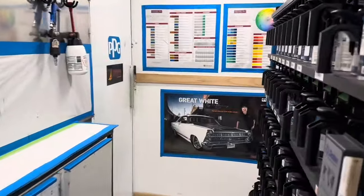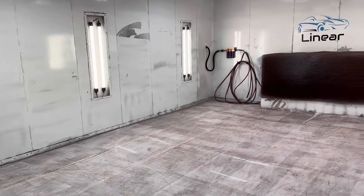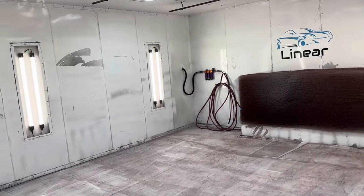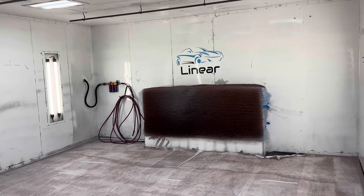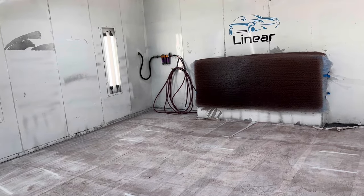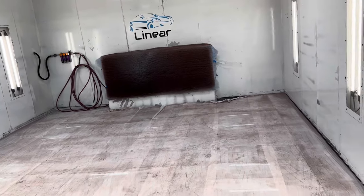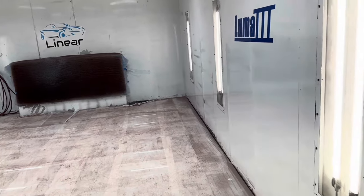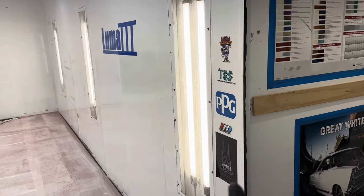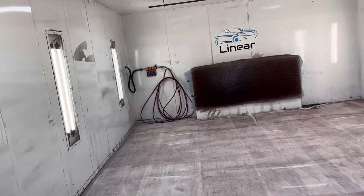And right in here is where all the magic happens. We just cleaned our booth out — painted some Harley stuff and a couple motors, but then basically just cleaned it out. Washed the walls, new booth mask on the walls, new dirt trap on the floor, new intake and exhaust filters. We revamped our exhaust venting and put some dampeners in so we can actually pressurize the paint booth. Instead of the exhaust sucking harder than the intake is pushing, we can adjust it so we can get the barometric pressure in the booth just right — the booth is pressurized so that when I open the door, the air is blowing out rather than sucking in. Any dirt coming in with me is getting pushed out instead of sucked in, and the few things I've painted since then have been way cleaner.